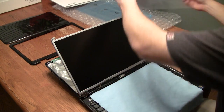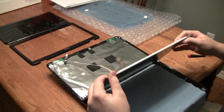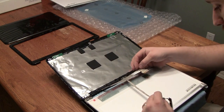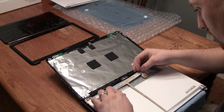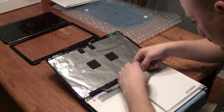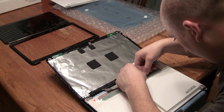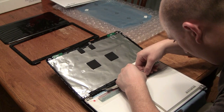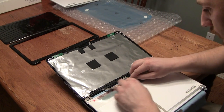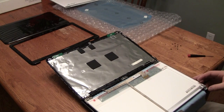Now is a good time to remove the remainder of the protective materials. Go ahead and fold it right back down on our microfiber cloth. Next, we're going to take that cabling and webcam and, without sticking anything to the back of the LCD monitor, you're going to first plug in that cable. Press it in firmly and it should give a light snap when it's seated. Once you have it pressed in, you're going to want to re-stick all the cabling where it was previously adhered to the back of the LCD.